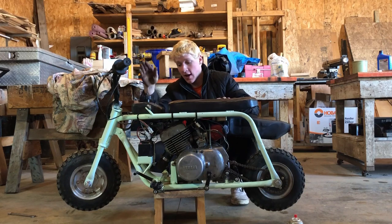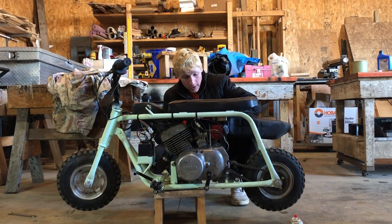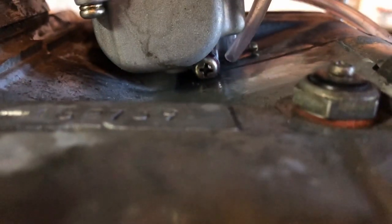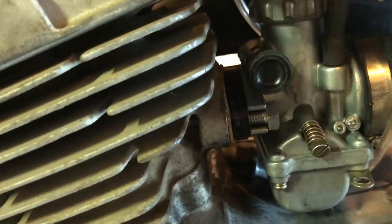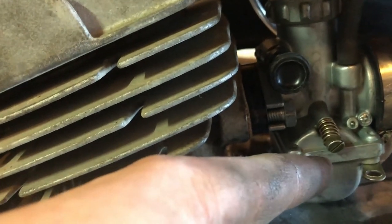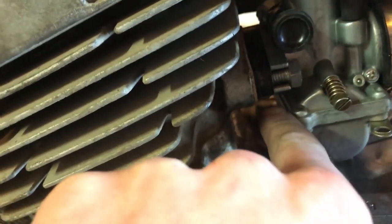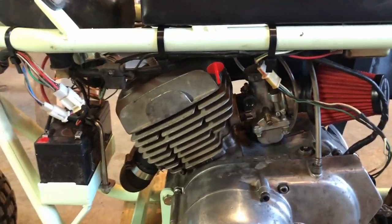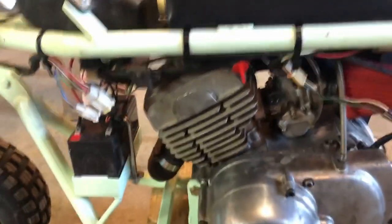I got everything put on — fuel and oil mix in there, carburetor and air filter on, so it's looking really good. But I'll show you one problem I had. If you look really close, there's no gap between the carburetor and the engine case — and that gap was even less before. I actually had to sand down a screw so it would fit in there. What was happening is the bottom part was pulling out because it couldn't push down far enough, so I was getting a vacuum leak — air being sucked in — and the engine won't run correctly because it was getting too much air.